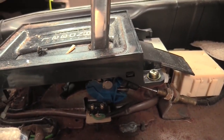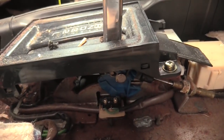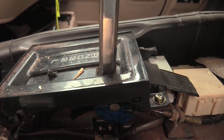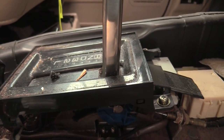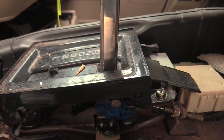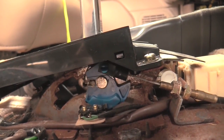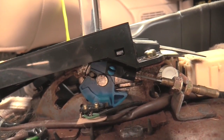Okay, first things first, when I press the button that allows me to move the gear shifter, you're gonna see that blue cam actuate, right? This is a mechanical linkage where this button is attached to a diagonal piece of plastic, and that diagonal piece of plastic pushes up another diagonal piece of plastic, and that moving up motion that happens here through the shaft is pulling up that blue chunk. Or down, in this case, and it's causing that blue pin to go down, and that's causing the blue cam to rotate.